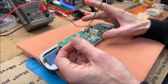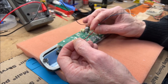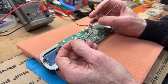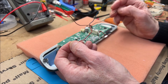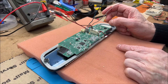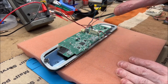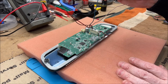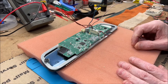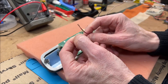Previous to LIN bus integration you might be able to take one of these mirrors, determine which is the switched 12 volt and which is the ground wire, and get the mirror functioning. In the case of BMW mirrors, most of them have a blinking LED on the bottom — in this mirror there's a single wire associated with that, which is the blue wire. The white with the black stripe is the LIN bus, and the other two wires are your switched 12 volt and your ground.